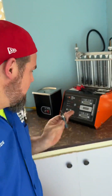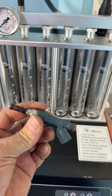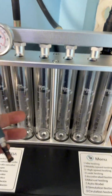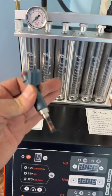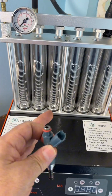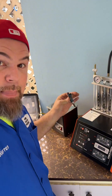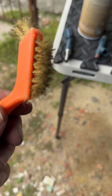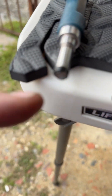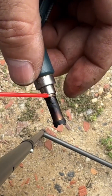This intake also requires a little love, but okay, let's stop wasting time and set up the fuel injector machine. Rule number one: before putting the injectors in the analyzer, you cannot put the injector just like this because it uses a fuel pump inside with a tiny filter. If you put the injector in dirty, you're going to contaminate the liquid and the pump inside. So clean the injectors in the ultrasonic first, make sure they're clean, and then go to the analyzer — that's how it's supposed to be.